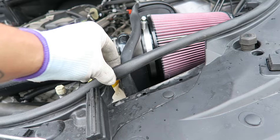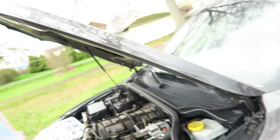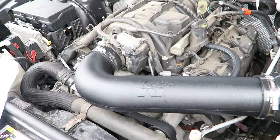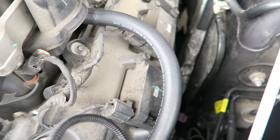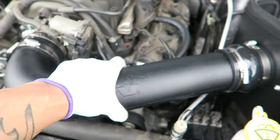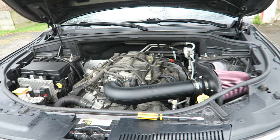From the looks of it, you're going to have this gap right here because of taking off this piece — you can actually just see through the airflow. But obviously once you shut the hood it's going to cover it up. I did not have one of the hoods that have the newer style, so water and stuff won't really creep through. At this point it's pretty much time for a startup to see how the start sounds and we'll go from there. Everything is in — got the extension plugged in, got the hose tight and sealed. I'll check it one more time to make sure it doesn't come off during driving. Everything is pretty much sealed and locked in for the cold air intake.